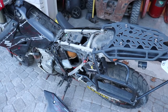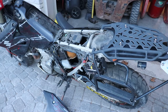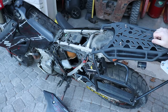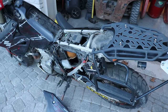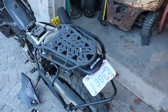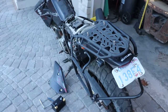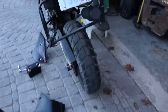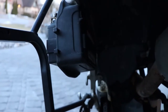Alright, we've got the battery exposed now. You just take the 10mm bolts off, pull the seat down and pop the seat off. Then there's a hex key — well on my bike it's a hex key; it would have been something else originally. You push down here and you can slide the plastic out. You'll see there's no front on this battery box. The back of the battery box is removed as well.